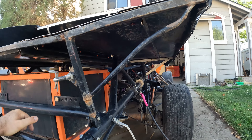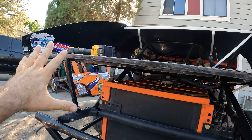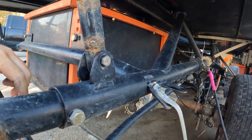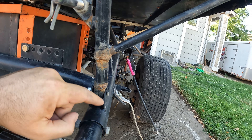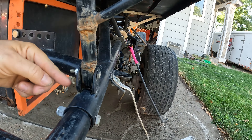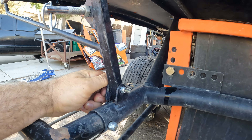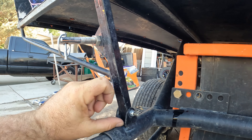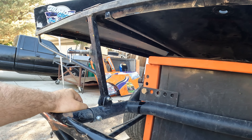I'm sure I beat it down a lot before. I'd like to get something kind of modular going on back here for that. I'd also like to make it adjustable for height. I had a bolt hole here - you can see it's down touching the chassis right there. I have another bolt hole that's actually a little bit lower so I can raise it up, but I ended up having to drop the deck. I'd like to make this adjustable at least up to an inch and a half, with an inch or two inches of adjustment.